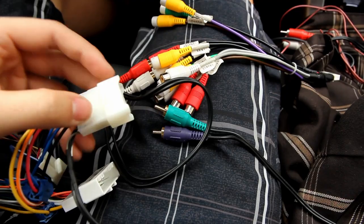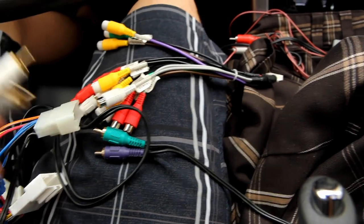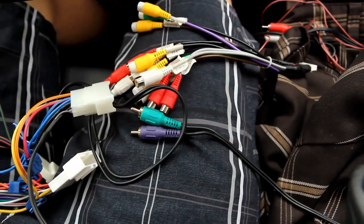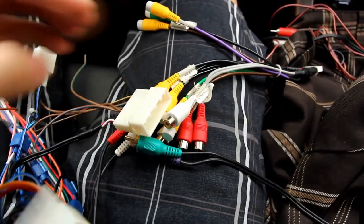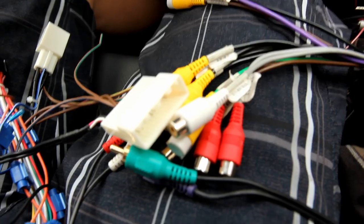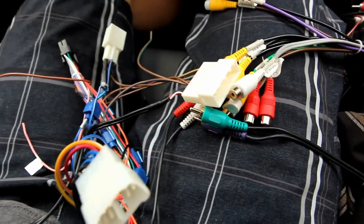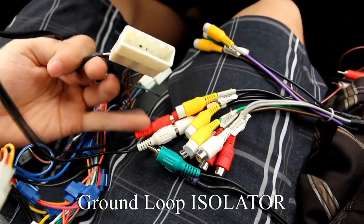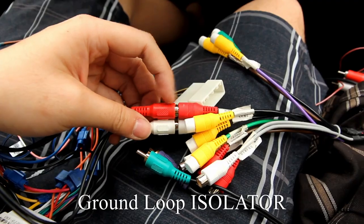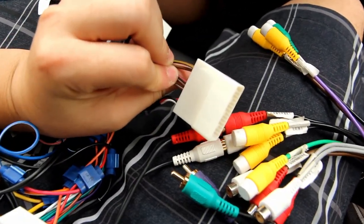With the AE64 harness, they supply the RCA jacks so you can plug straight into the unit. The next one is the 28-pin. With the 28-pin, this controls the AUX — so when you want to plug things through AUX, which I already have plugged in, you get AUX input from this connector.